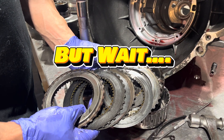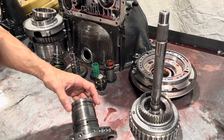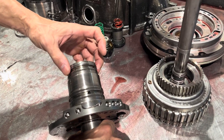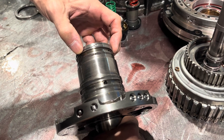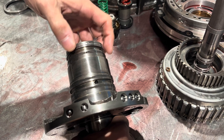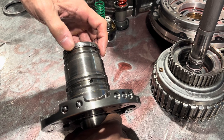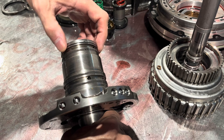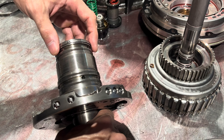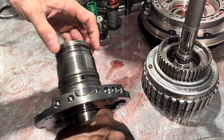As we got a little further, I can see why the forward clutches burnt out. These two rings are two different colors - this one is completely trashed, you can see the side clearance. I don't know what caused this, maybe it was never changed in the first place. What happens is this ring is supposed to turn with your drum as your drum turns. If that stops happening, the drum keeps turning and the ring stays stationary, and it wears it out very, very quickly.